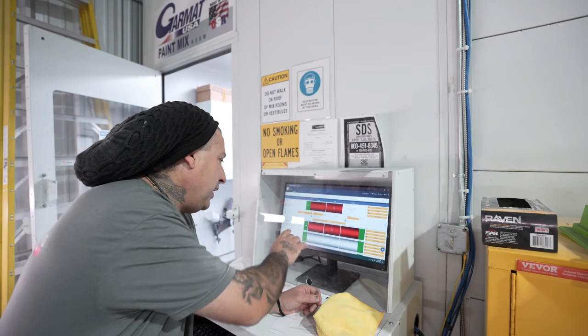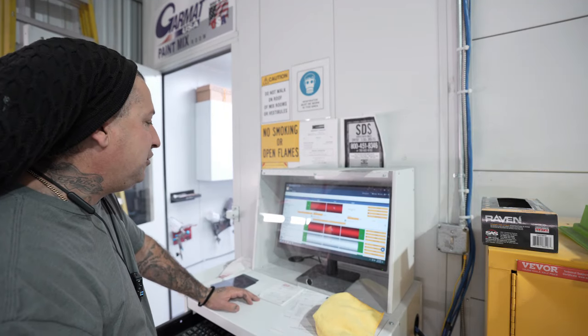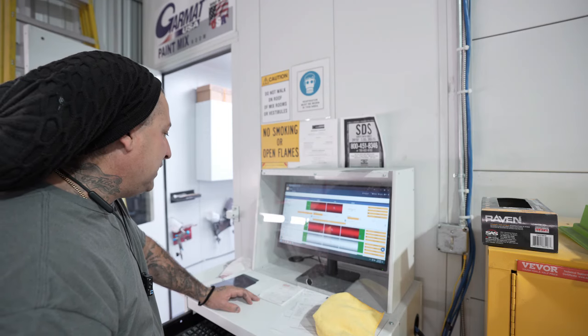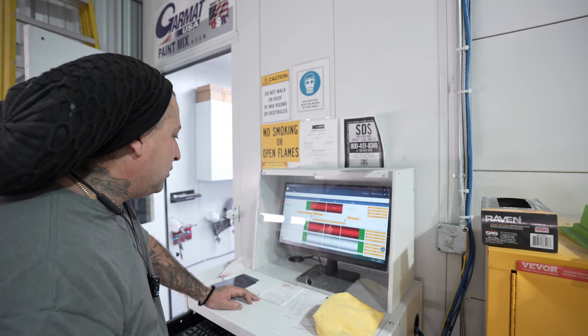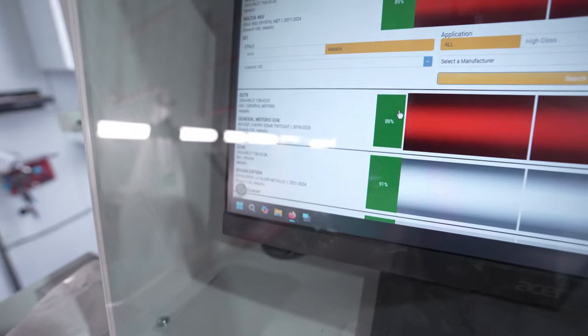So we're gonna go ahead and use our 89, because you guys know in Glasurit we don't have chips. We shoot it with the camera and then we do a spray out as we're doing the job, especially with something like this, to verify how many coats of Kandy you're gonna need to get your color. So this is Cherry Bomb tint coat. Let's go ahead and get this thing mixed up, and then we'll start putting our sealer down in our base.